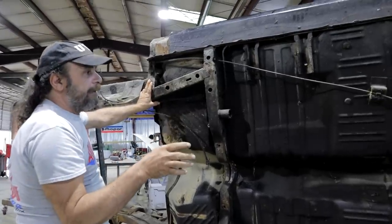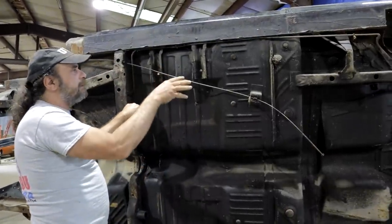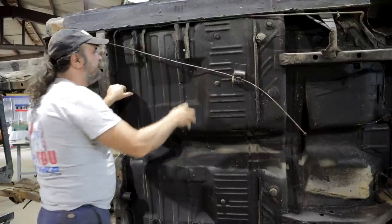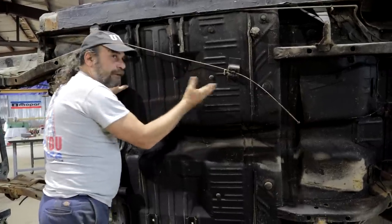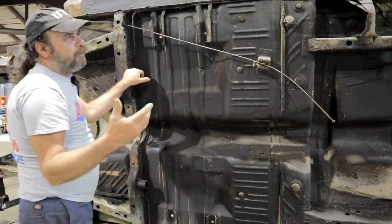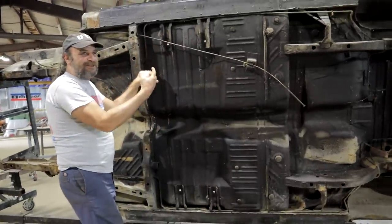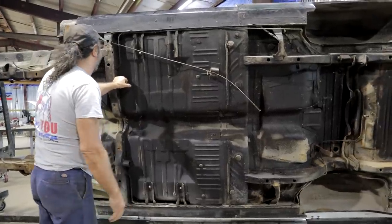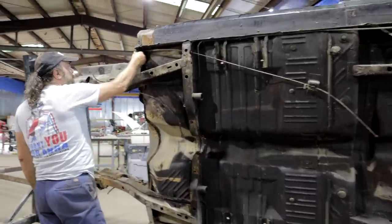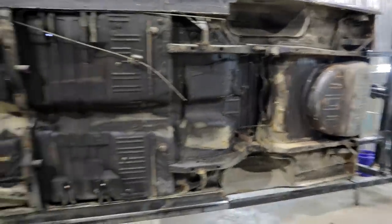Those are the common problem areas. Naturally you'll find floors rusted, but generally speaking it's not a fault of the unibody construction — it's the fact that people will leave the door cracked, or leave the windows open, it rains, and the original jute backing holds moisture forever and rots these floor pans out. It's not a fault of the car's construction but more of the care and feeding of the car over its lifetime. And this thing was loved — nothing was ever allowed to enter this. It was hermetically sealed. It's like going back in time. This is a spectacularly clean unibody — there's minor damage here where somebody probably put a jack underneath it, and that little bit of rust over there, but I can't find anything else.